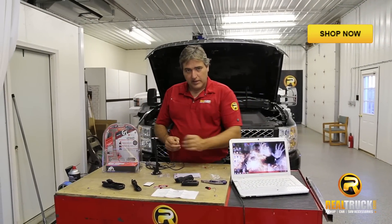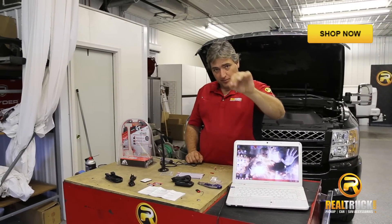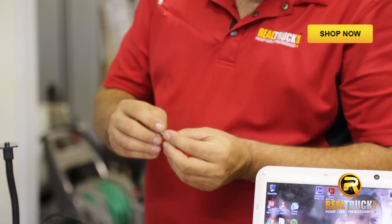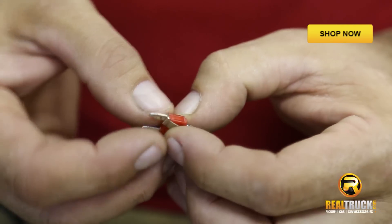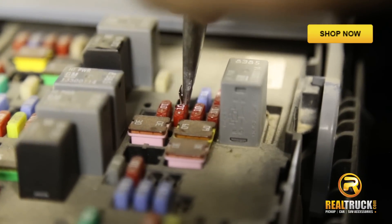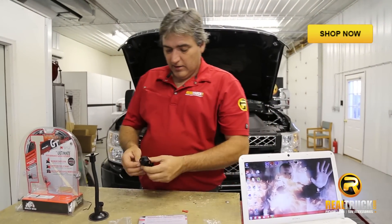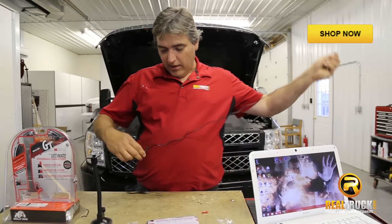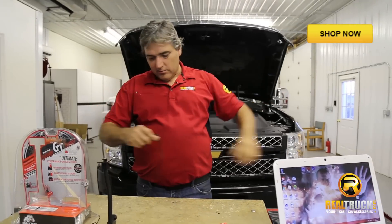What we have in our kit comes with a wire connector and also this neat little adapter for our fuse. What you do is it has a slot in the end of it and you slide the prong of your fuse through this, so you can see how it slides onto that prong. Then we'll slide it all the way up against our fuse housing and snap it over, put this fuse back into our spot, and then this will go on the end of our power wire to allow us to get power to our programmer. We'll attach our power wire and leave it off until we get this wire ran through the firewall to get it to our programmer.